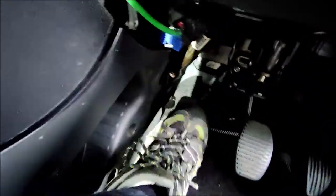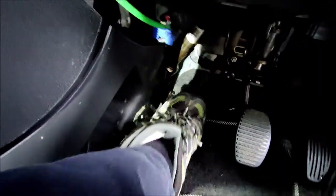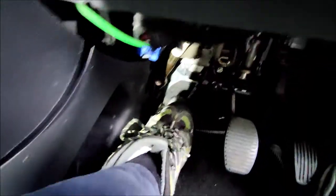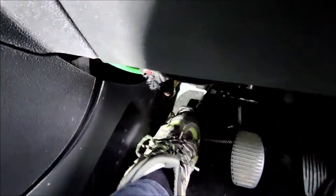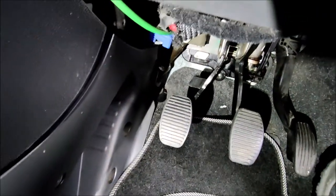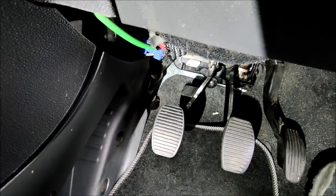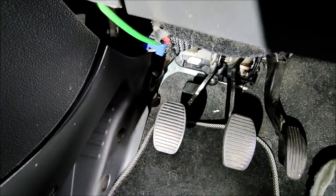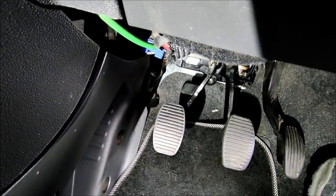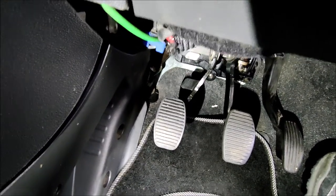There we are, back in the car, back by the clutch pedal - let's see if that squeak has improved. It's much better. There's no sort of stickiness through the pedal anymore. There is a slight creak but I think that might just be the pedal assembly, which these are kind of renowned for - nothing that would affect your enjoyment of driving the car. But that's a definite improvement. So there you have it: if you have a creaky sound and you can feel it through the pedal, it's most likely your slave cylinder. Thanks for watching, please be sure to subscribe and click like - bye bye.